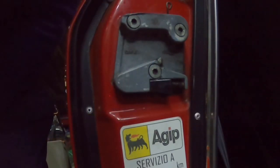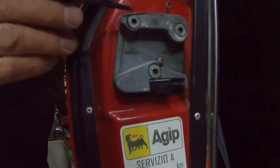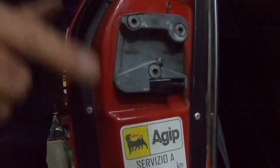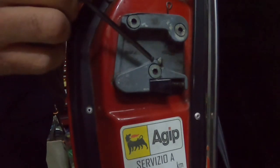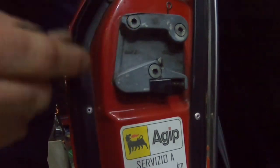The door locking mechanism and the striker plate — when the door comes in here it's got a bit of wear, which is not too uncommon, but also up here. I think the door has dropped; that's the reason why we got the issue with the hinge. The wear down here and the wear up here is a telltale sign that it's lower than it should be.